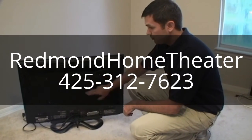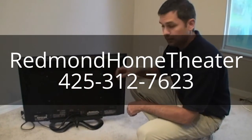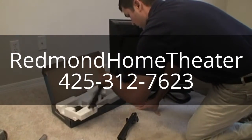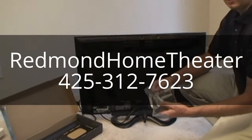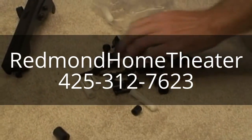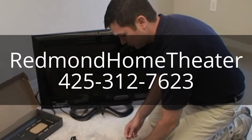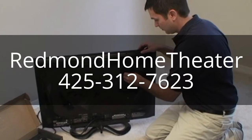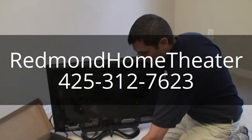On the back of your television you'll find four screw holes. Sometimes they have little rubber grommets that you'll have to pop out — this is where you're going to attach the arms of the mount. All the supply screws you need are right here in your hardware kit. They're very heavy-duty screws. Sort through them and find the appropriate screw that fits your model television; the rest are spare parts for other televisions.